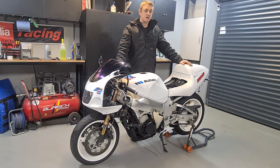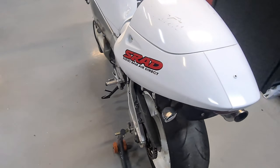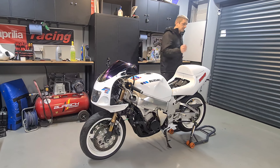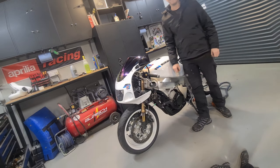Right then folks, that seems to run sweet to me. I don't need to do any tuning or altering or anything else on that now. It did start off a little bit groggy, but after that fuel injector cleaner and some fresh fuel got through the system it just seemed to open out and run pretty sweet. I've adjusted the idle on it — just dropped it down a little bit and it seemed nice and balanced. I'm not going to do any more on this now. Check the coolant in there — it looks quite fresh, so I'm not going to change that. That's all for this bike now, so I'm going to get the fairings back on it and give it a good old wash and polish. We'll see you next time — next project, possibly GPZ, so stay tuned.